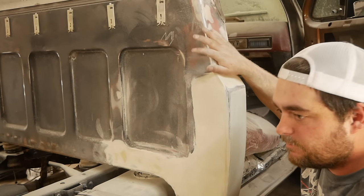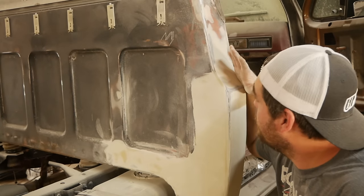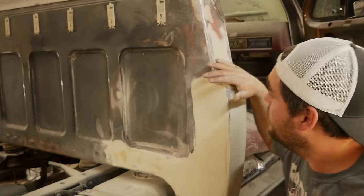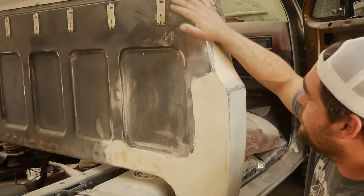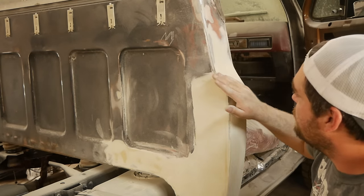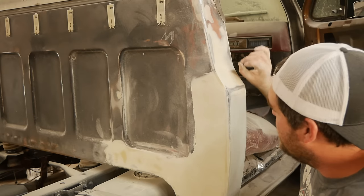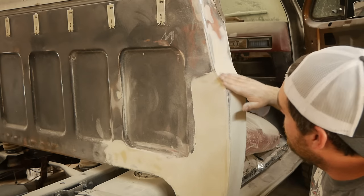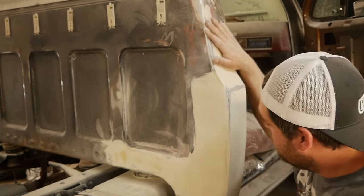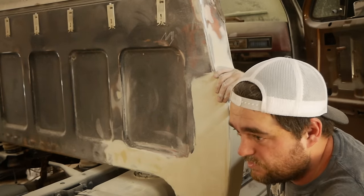But you've got to remember, this is not the end result. Now, I have probably 3 or 4 coats of primer, and block sanding is your end result. And that's where you do your real body work. Basically, you're just trying to lay a good base here, a solid foundation to work from. This coat of filler is maybe a credit card, probably not even that. It's very thin, but it's just enough to smooth it out a little bit that we could take her the rest of the way with primer. You know, if you could bang that into your head, you'll have a lot more success. Just know when to stop.